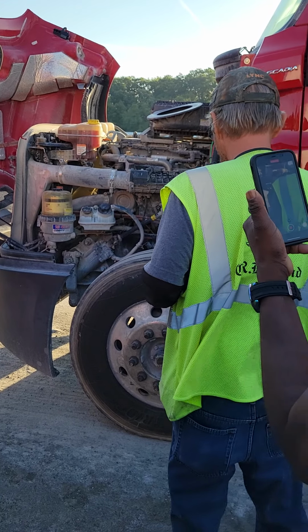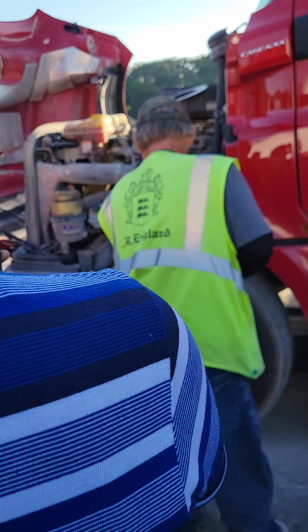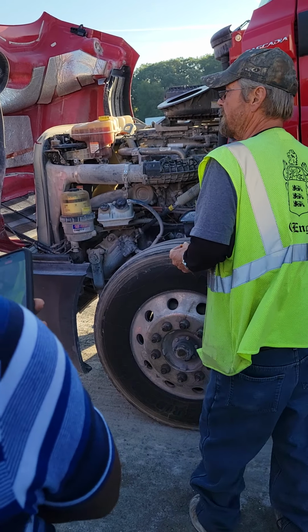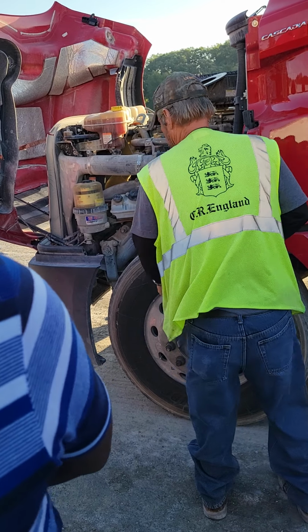Wheels and rims: not cracked, bent, or broken, mounted and secured, no illegal welds. Lug nuts, none missing, not cracked, bent, or broken, mounted and secured. No signs of shiny threads or rust trails around the studs.